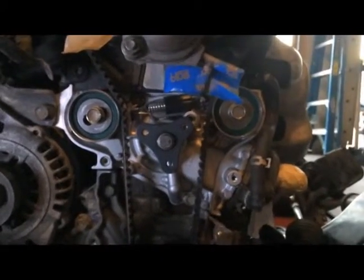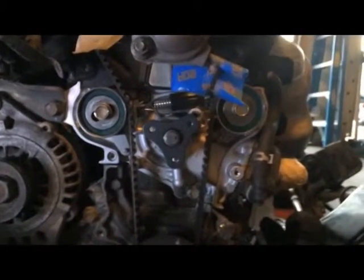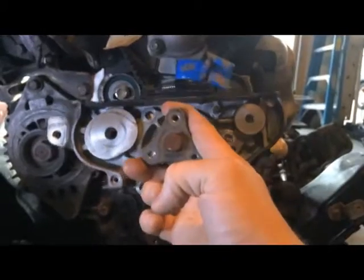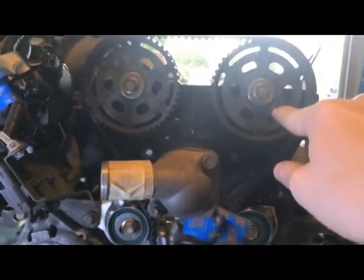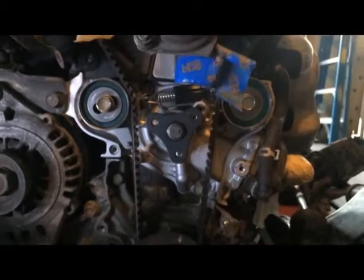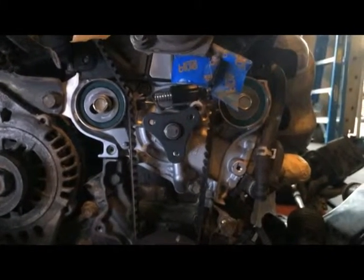I'm virtually complete here and I have to apologize — I forgot to take video while I was in the middle of the water pump replacement. It gave me quite a bit of challenge. But as you can see, I've got my nice new shiny water pump in place. Here is the old one. One thing I learned: you don't have to take those pulleys off. The black plate appears to overlap but does not actually overlap the water pump. There are a few gaskets and then one that mates to the actual engine block. It's really just a quick replacement, but I made it a lot harder than it needed to be.